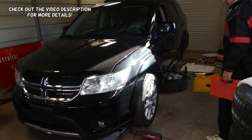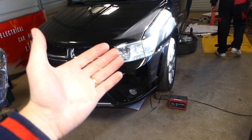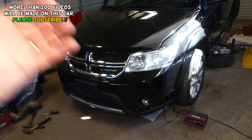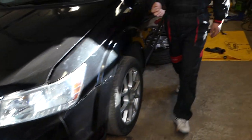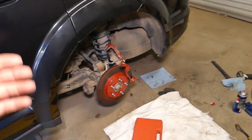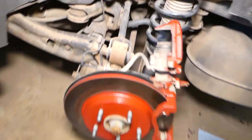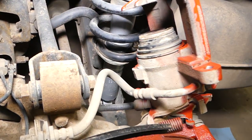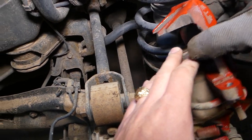Welcome back to Our Repair Guys. In today's video, we'll be working on a Dodge Journey. If you have a Dodge Journey from 2009 to 2019, or Fiat Freemont as it's known in Europe, we'll show you how to compress the rear brake caliper piston. When you put new brakes on, you have to compress your caliper piston all the way in, because otherwise your caliper will not fit over the new brakes.